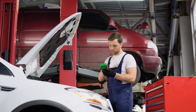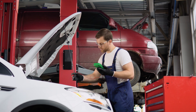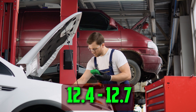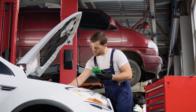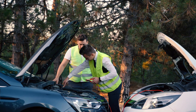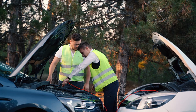Use a voltmeter to test your battery if necessary. To obtain a reading, touch the prongs to the corresponding battery terminals. 12.4 to 12.7 volts indicates that your 12-volt car battery is charged. Low voltage is defined as anything less than 12 volts, which means your battery might not be able to start the engine.